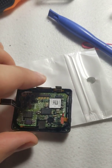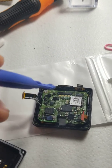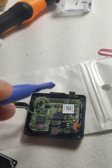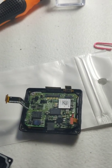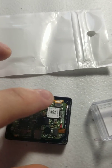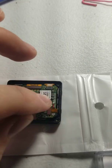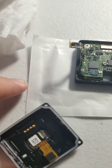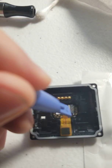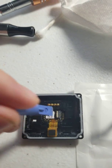We're almost done. We're going to put our press fit connectors back on. The best thing you can use for anything like this type of work are these plastic spudgers — they usually come with repair kits and anything plastic is usually good because if you slip, it's not going to really damage the board nearly as much as if you're using a screwdriver or anything metal. After you put your press fit connectors on, you'll feel little pops. The best thing you can do is with your finger or that spudger, feel those little clicks and give them a little rock to make sure they're actually solidly on there. Before you put the other half on, some videos had this connector as black but it's white on mine. You lift this little connector up, go in from the side and pop that little connector up. You want to wiggle that connector started underneath that black part and wiggle it back and forth and work it as far in as it'll go.